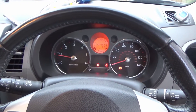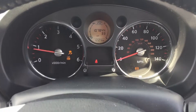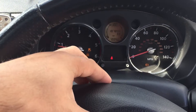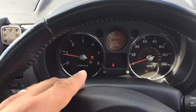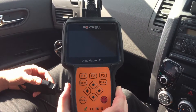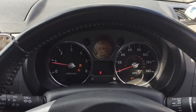You may find that your ESP light comes on when you turn the wheel. So after all that work, we've got a bunch of lights coming on — the dashboard looks like a Christmas tree. It's primarily because the encoder behind the steering wheel hasn't been reset, so it doesn't know where zero is — it flags the electronic stability lights, ABS lights, and that kind of stuff. My mate Billy here has got a computer and we're going to plug that in to reset all those lights and reset the zero position of the steering angle sensor.